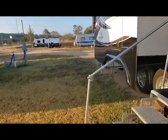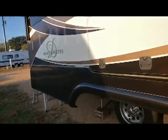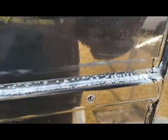But anyway, we've talked about the Acrosolve as far as removing the silicones off the RV. Well, Lexel is an adhesive sealant. So I've discovered, messing around with things, that the Acrosolve does not do a very good job on removing the Lexel. Mineral spirits or anything based in mineral spirits is what you're going to use to remove it.